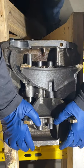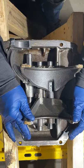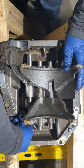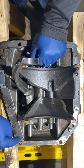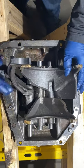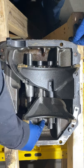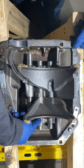Now, this system, I can go like this, and that freezes the ball bearing out. So this one won't move, and this one won't move. Now the two ball bearings, there's a little cut groove in there. It can move around. When these two are like this, the reverse can move. You can see the cut in the side right there, and obviously another one right there. So that pushes over and it freezes these, they can't move. If I pull this back, it allows the ball bearing to move over, allows it all to shift. There's a little pin in this rod. This pin is what was frozen.